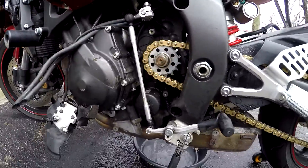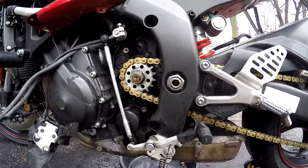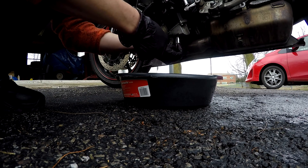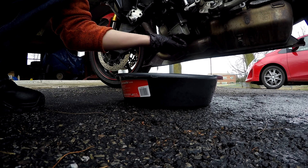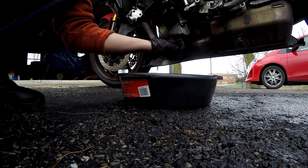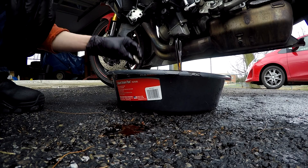There was a lot more stuff that had to get out of the way before I started it. Right now I'm letting it run, and then I'll lube the chain and after I'm done doing that I'll change the oil. Getting that bolt out for the oil drain — careful, that exhaust pipe is really hot. I generally prefer not to drop the bolt into the pan, but if you do, it's not really a big deal. Definitely want to wear gloves because the oil is really hot. That is some dirty, dirty oil.